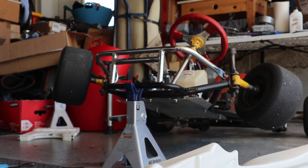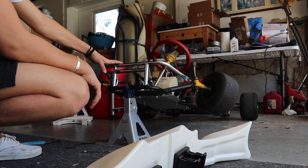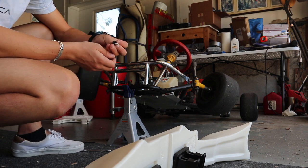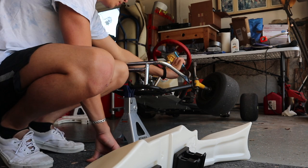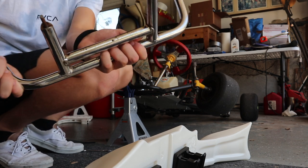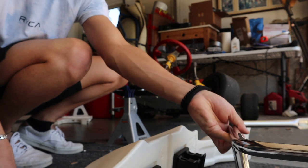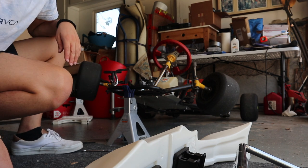I have the cart up in the air right now and I'm taking out the bolts that support this bar so we can put the new one in and mock that one up. Here's the old one. One of the bolts actually got seized on the inside on this side as you can see it's still in there, but I decided not to cut this one up and ordered a new one, so if I did want to run this bar again I could.